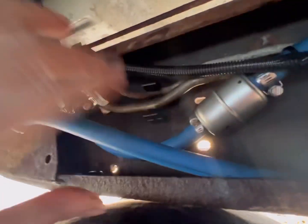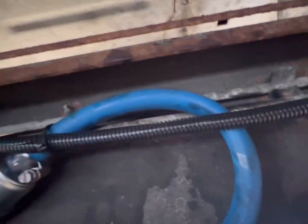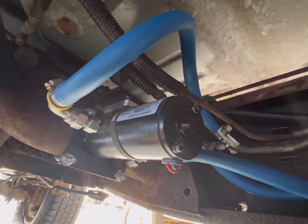Cut and double-clamped, it goes into our inline fuel filter — as you can see the arrow here indicates directional flow so it is correct. This comes around and goes into the FAST. The reason I did the loop like that is to buy me some room so I can actually change this filter easier later. Here's our electrical plug for the FAST — it runs up along the frame rail, zip tied in place, and runs up the ABS lines to the engine bay.